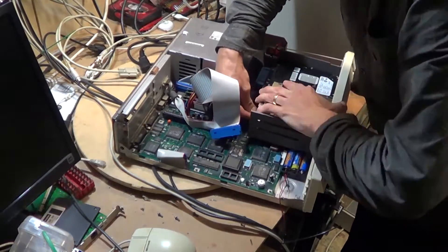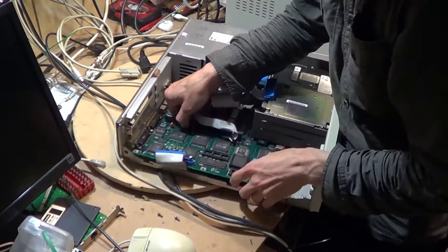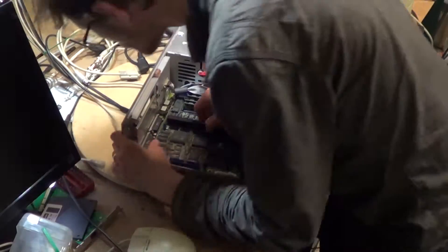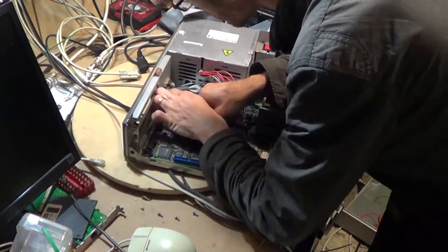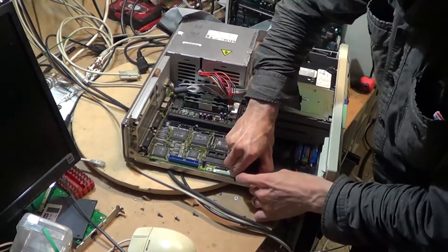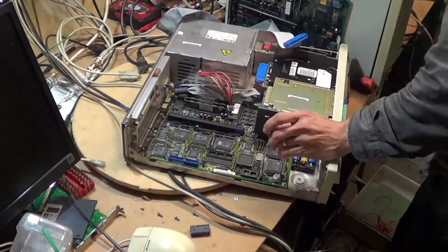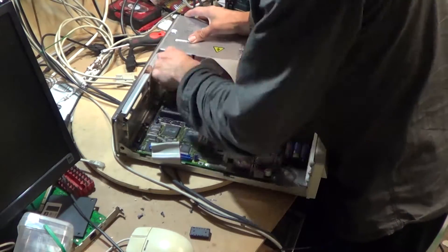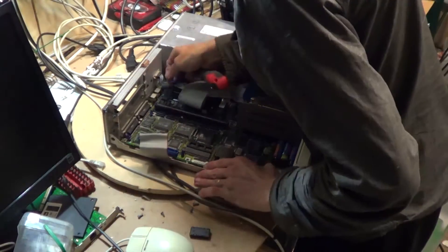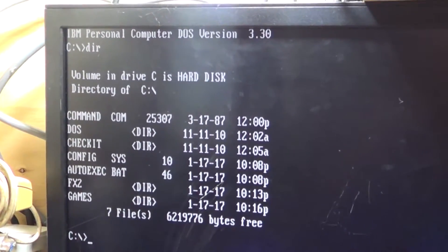First we've got to rip out the original motherboard — just disconnecting everything, pulling out the real-time clock, and sliding the motherboard out. Here's the new one going in. You'll notice it's a different revision of the same motherboard — I didn't know they made different revisions, but apparently they did. This one doesn't have the tantalum capacitor, which is a nice bonus. I'm removing the original Dallas real-time clock and fitting the one already attached to my battery case. The nice thing is it's going to take my settings with it, so I won't have to use the starter disk to boot. With everything hooked up, it's time to hit the power — and sure enough, it booted absolutely fine.